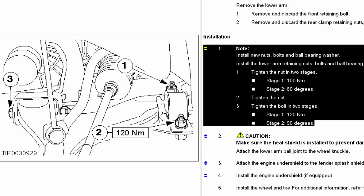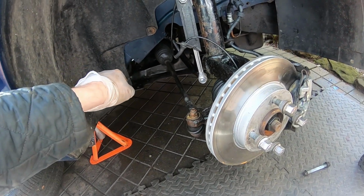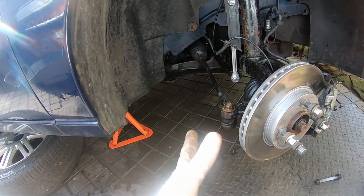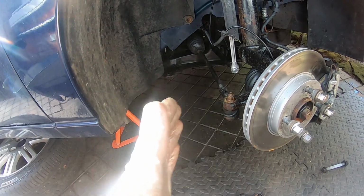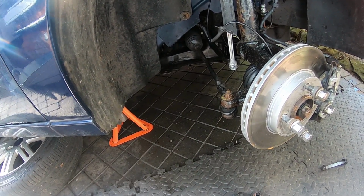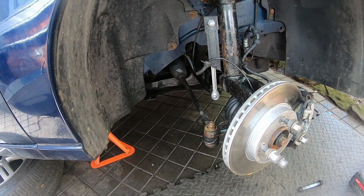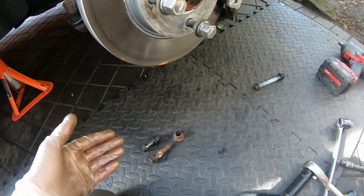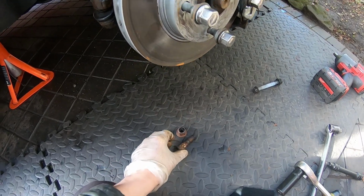But yeah, just something to be aware about, try and torque it up by as much as you can. Believe you me, when you're wrestling with the swan neck spanner and then trying to go in with the breaker bar, trying to do that, well, what would be 90 degrees, I think it was 90 degrees for one of the bolts. Trying to do a right angle 90 degree turn is back breaking, and most garages just get the gun and whack it up. There's no accuracy, and I've never known an issue by not torquing them up if you cannot fully turn that stretch bolt. And yes, by nature, of course, stretch bolts are not meant to be reused, but do you know how expensive these are? Yes, we reuse them.